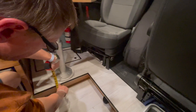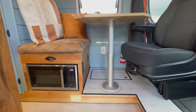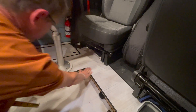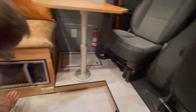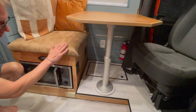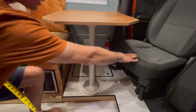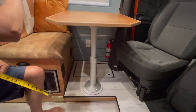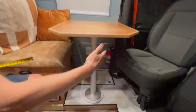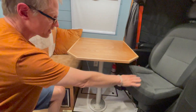I built this platform at the same level where the seat comes out, and this platform is six inches tall all the way to the top. When you build your bench, it needs to be about as tall as your driver's seat so that someone sitting in the driver's seat and someone sitting on the bench are at the same height. I see a lot of vans where the driver's seat is way higher or way lower — it's important to get them at the same level.